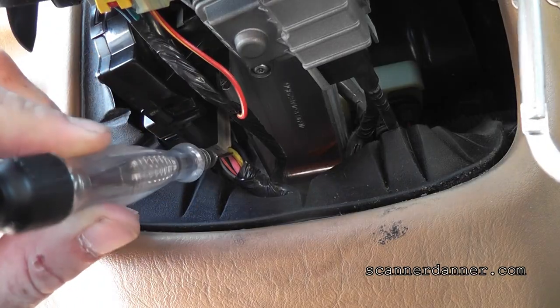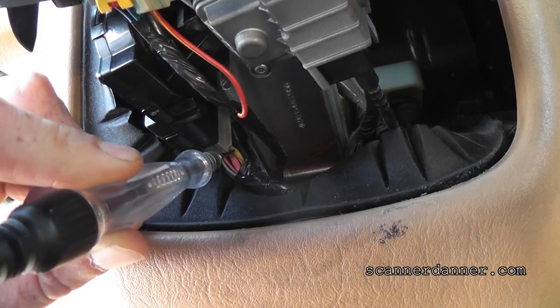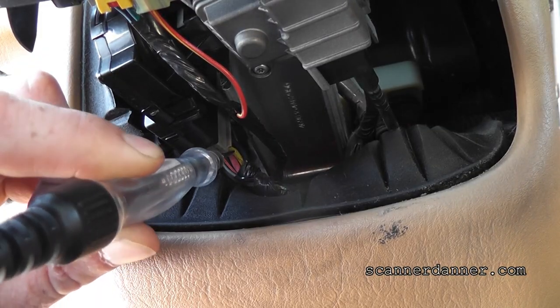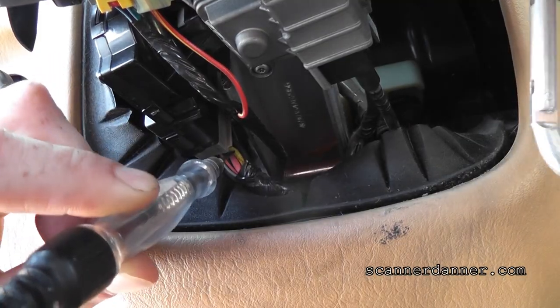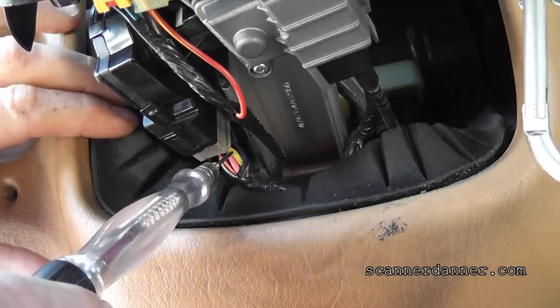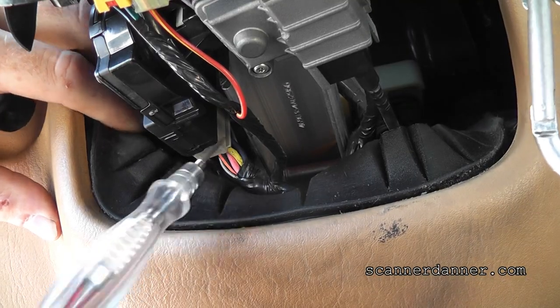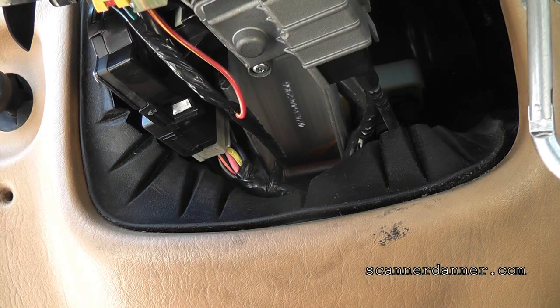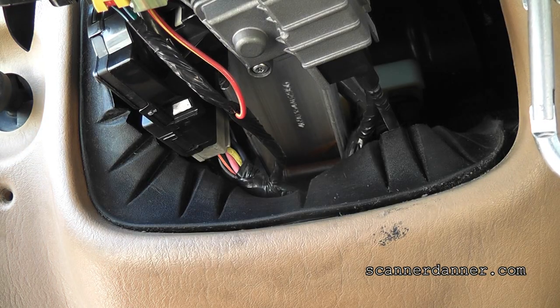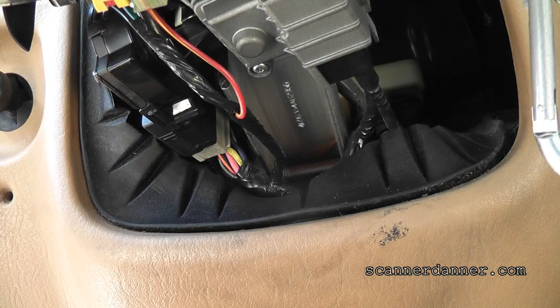Going back to my yellow wire — that is the crank wire — and it's not lighting up. From what the garage owner told me, he's already replaced the ignition switch. So at this point, that would really be my call if he hadn't done that already.